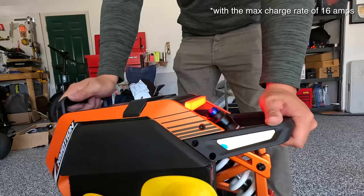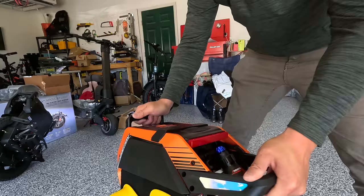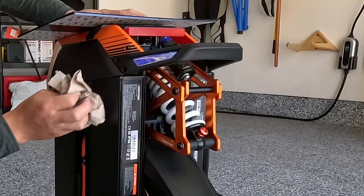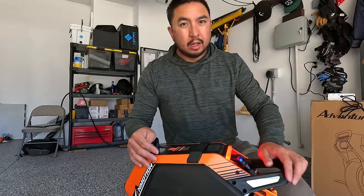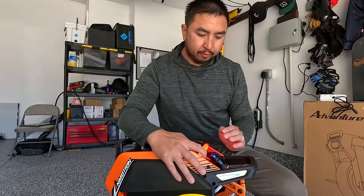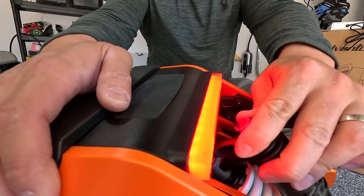Then we have another handle back here — it's just a handle, there's no light built in. The brake light is up on top of the body; it does flash when you're braking. Right below that we have the progressive suspension. In the previous versions — the V11 and V13 — you had dual air suspension located in the center, and a lot of people had issues with that. This is the first time we've seen them use coil suspension with this type of geometry in the rear. You can adjust the compression on top on the go without any tools, and you can also adjust the rebound on the bottom.